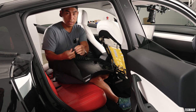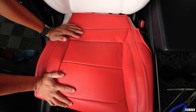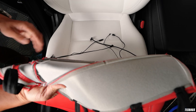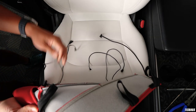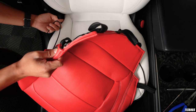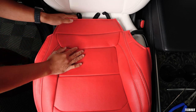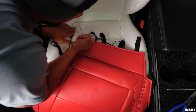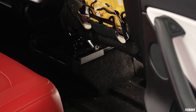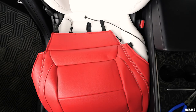Now that this is removed, start covering up the bottom part of the seat — relatively simple, just like the rear seats. We do have to go through here where the seat kind of lies down; this corner right here is what we're going for. You really just need one of the lines — the strap goes around this and pulls in from the back side, hugging the seat down, and then clips underneath. Use the big needle and go through this segment — go in at an angle, push it all the way through, leaving about three or four inches of thread. Pull it through.